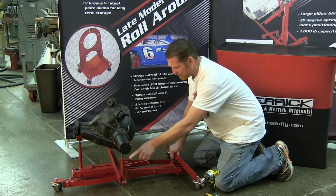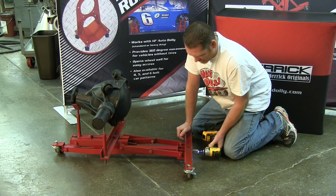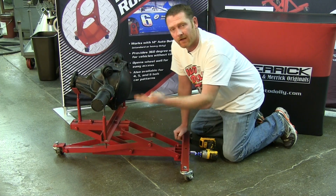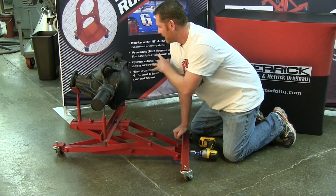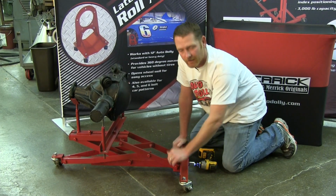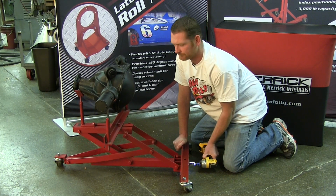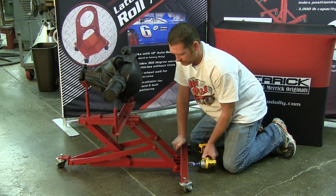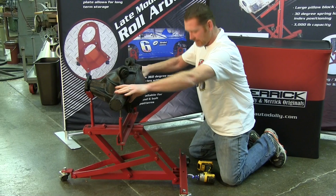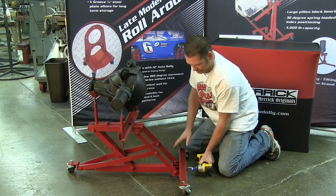You'll get underneath here. You'll set your parts here. You'll set your tubes and your space and everything for your differential. Then you'll jack this up. Get underneath, catch your differential, and loosen all your upper and lower control arms that are on your differential, or your leaf springs, whatever you're doing. You can do it with your leaf springs on, whatever. Unbolt everything. You can run it all the way up. You unbolt everything, torch it off, whatever you guys are doing. Then jack it back down.